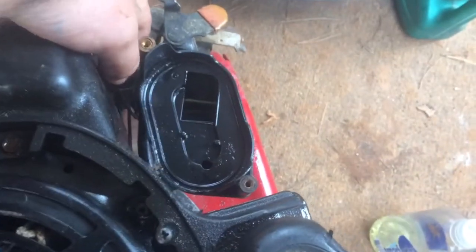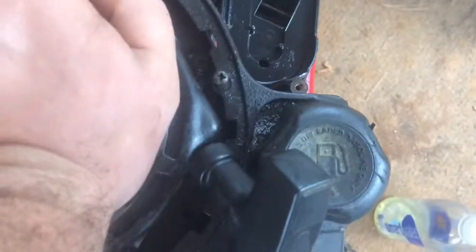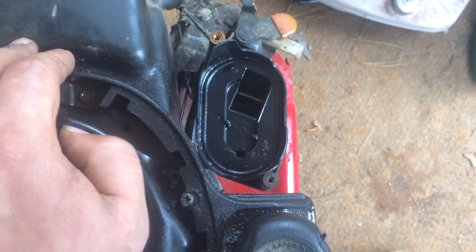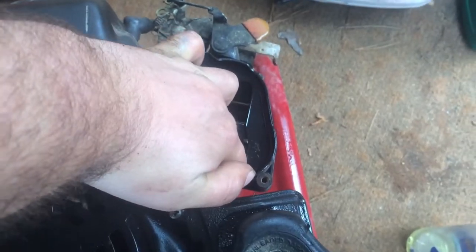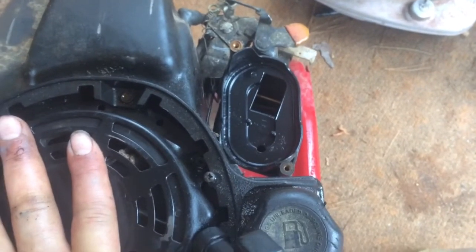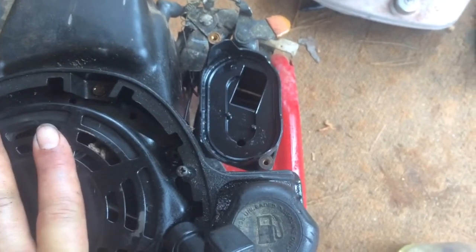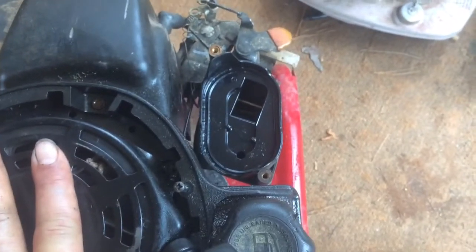This thing's moving up and down every time it would idle high. So I guess we'll go and ponder it for a minute. But I mean, you can keep it going on a bottle. I'm thinking something's either just off with whatever sets the idle for this thing, or it's not pulling fuel through. And so when you feed it from the top, it'll run, but it's not pulling it all the way through the carb, which means we might have to do a rebuild, which sucks.